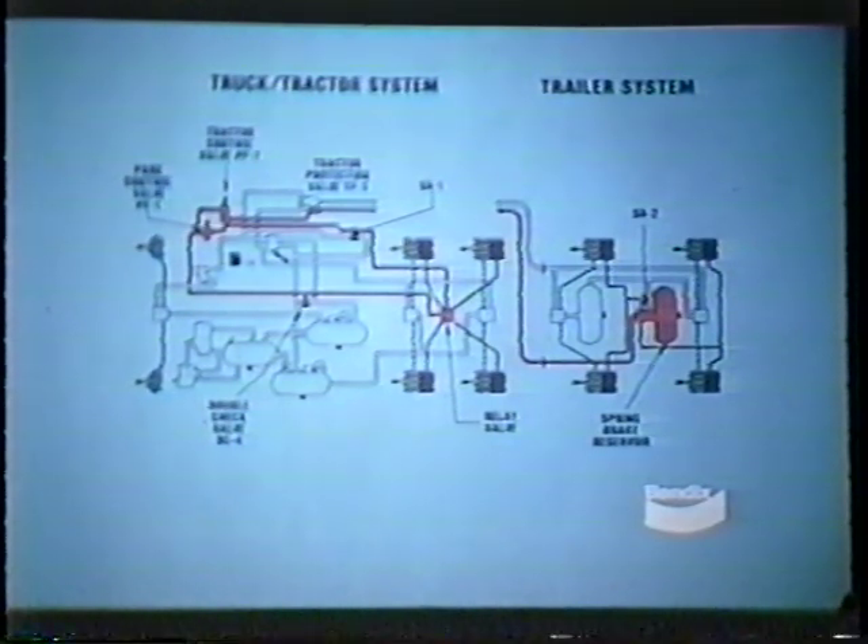In the schematic shown here, only those lines and components colored orange are involved. Causes for excessive leakage must be found and corrected before proceeding with any further testing, because they will be additive to other tests that will be performed.